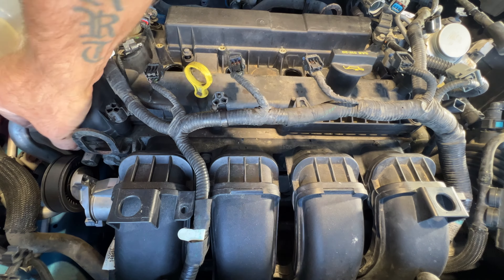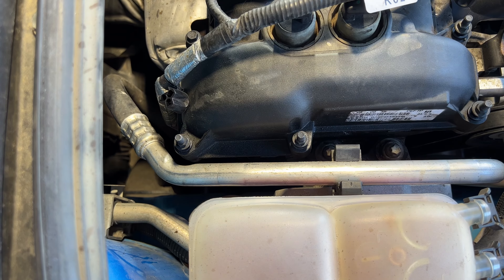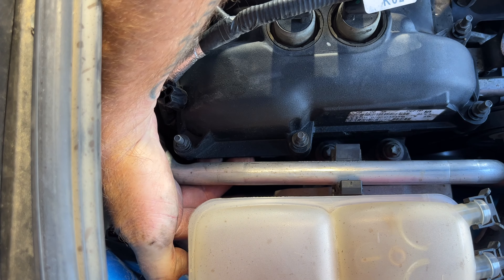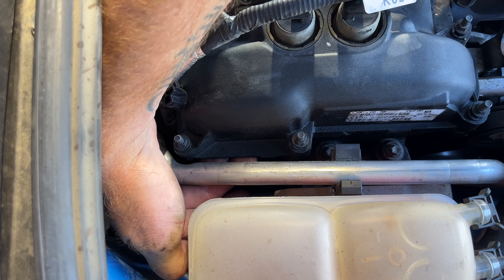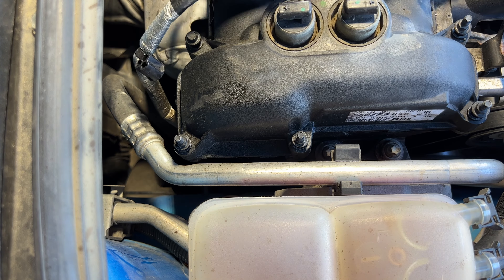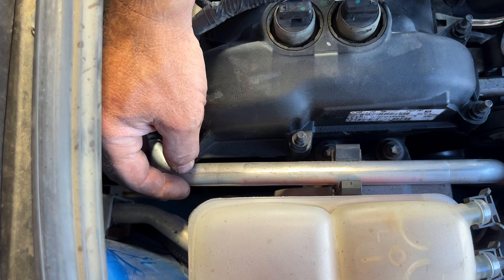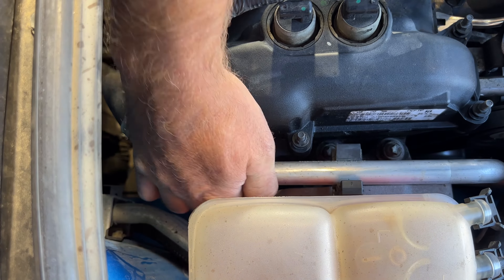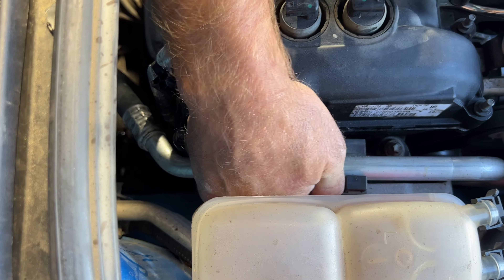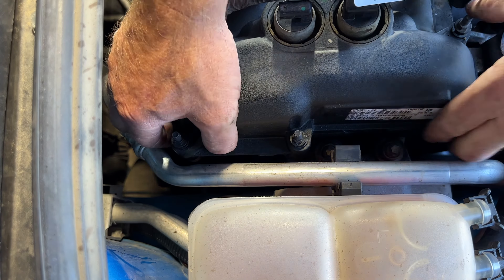I think we're separated over here on the back side. There's not really any spots on the back here to pry, but there is a spot right here on the passenger side — there's this little lip here you can get your fingers under. What we're trying to do is just lift this up evenly because it's hard getting it past the VVT solenoids. So if you can kind of pry this end with your tool and then use your fingers to pry up on this side — you can see it wanting to work its way off.